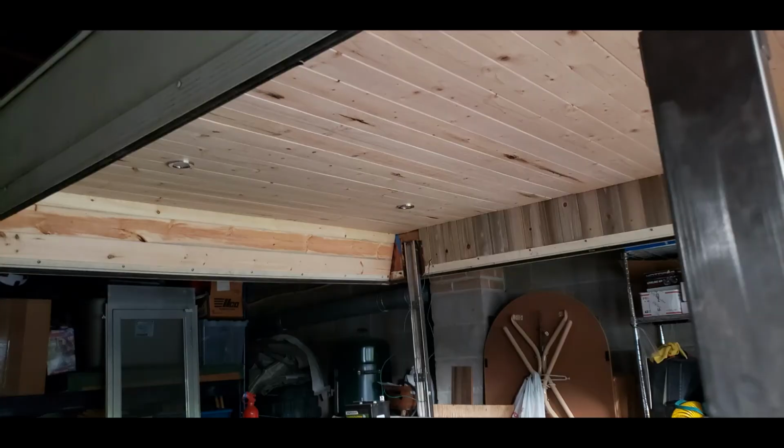Now, the only thing that I didn't take pictures of that you won't see in here is the structural integrity. This is the side where the styrofoam was missing, so I had to buy some high density styrofoam, cut out the whole end, and then I had to put structural 1x1s on each corner, and then along the roof, the whole span from front to back is a 1x1. It runs the whole length down the middle and down both ends front to back, so that I had somewhere to nail the wood into to give it support and structure. But not only that, I could disperse a little bit of the additional weight that this was going to add to those 4 posts where the pop-up actual rails are at.